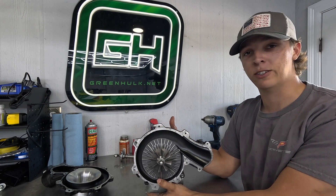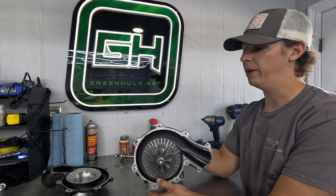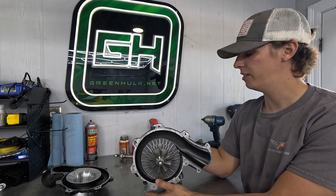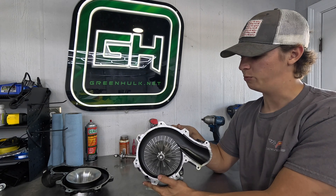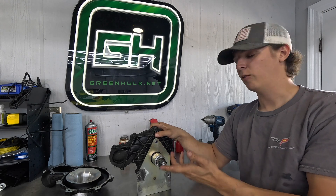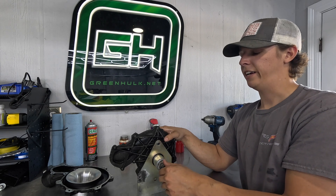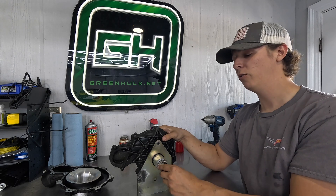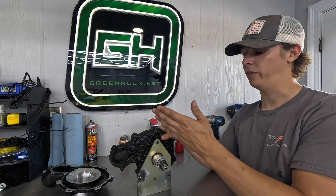A little noise is kind of normal — that's just a very minimal amount of bearing noise. This supercharger does not see any oil pressure when it's out of the ski, but when it's running you do have an oil squirter going directly to the back of it making sure everything's lubricated. When I rebuild them I do pre-oil everything, so there will be oil in the bearings when I ship these out so everything runs nice and smooth. Now I just have to put the front housing on and we're going to set the slip. Setting the slip is one of those things where I've heard a thousand different stories — I've heard dealers or shops saying you can't reset the slip and have to buy a complete replacement supercharger if the slip's too low, which is not the case.